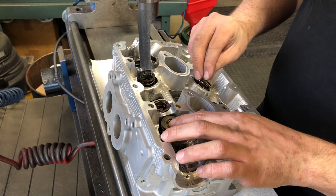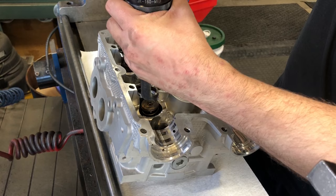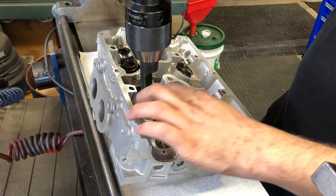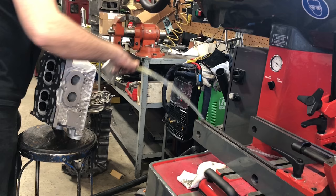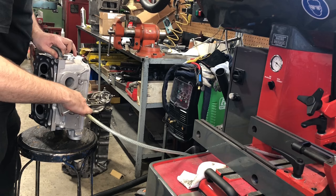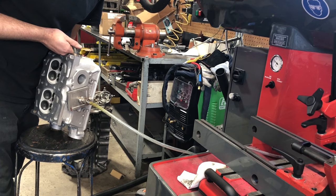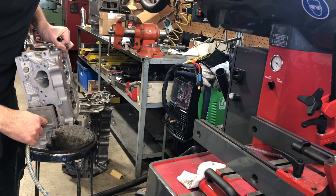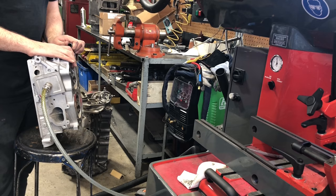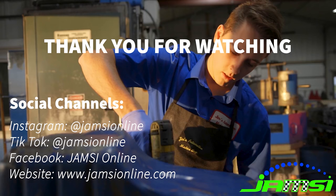The best way I've found to install those pesky little keepers on these small valve stems is getting the head up on our old valve seat machine with a spring compressor adapter in the drill chuck, setting the keepers in place on top of the retainer, and gradually working them into place. You can do three in a row that fall right into place, but the fourth one is going to fight you to the death. As always, the one last check we will do is a vacuum check of each port — we already checked this earlier when we were cutting the seats, but it's just one last check for peace of mind that we finished our job correctly. Thank you all for watching — don't forget to drop a comment, like, and subscribe to follow our small business journey. We'll see you next time.